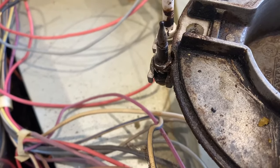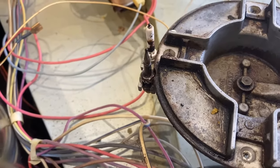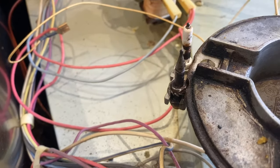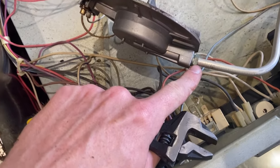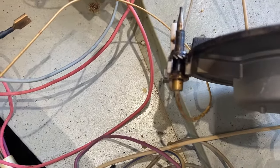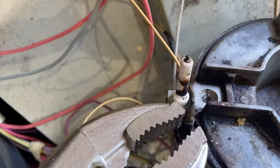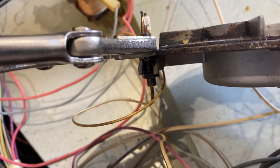This little bolt on the top of the thermocouple is quite hard to get off. I've tried with a spanner, I've tried with mole grips - I'm just going to be slightly destroying the edge of it. I'm going to spray it with WD-40, give it a little clean up, and might try and get it from the bottom. I undid this a little bit just a touch so I could spin this thing, and that enables me to get access to the thermocouple. The way I've managed to start unscrewing it is to put some mole grips on the top nut and just use a normal spanner for the bottom, slowly undoing it.